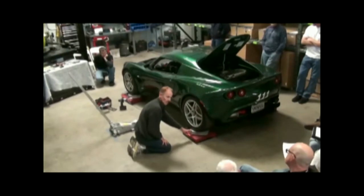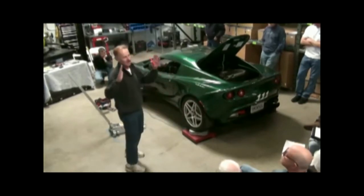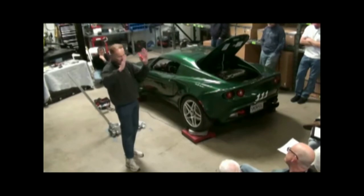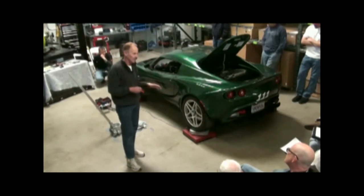When we do scales, we put the scales on the plate because if you just put the car on the scales, the suspension tends to be loaded. It will be more vertical and it binds a little bit on the scales. Does it really matter? It's a few pounds — probably not. But that's how we do it.